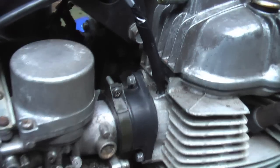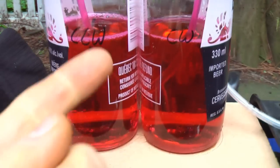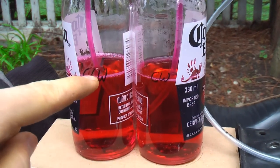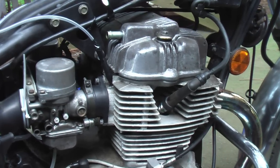Here's my little rig — I've got one tube connected into the first synchronization port, the other tube connected into the other port, and that leads back to the device I made. With a Sharpie I've written 'counterclockwise' and 'clockwise' on the bottles. I worked out that if I twist the synchronization screw clockwise, this one will rise; if I twist it counterclockwise, the other one will rise. So if it's going like this, I know I have to twist it counterclockwise to bring this one back up.